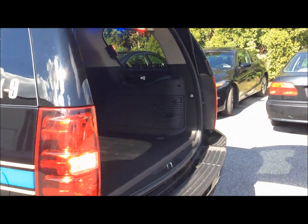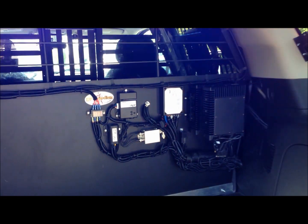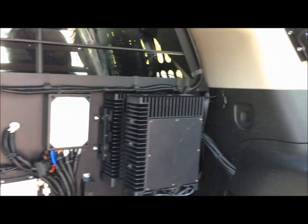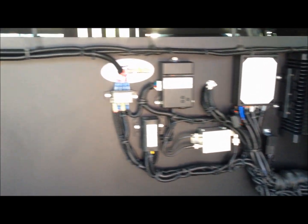In the back, you can see how we mounted everything. It's very sophisticated in wiring — everything is nicely mounted on the back of the cage, with custom fuse blocks, everything in wire loom. There are probably 100 wire ties right there in the cage. Nothing that we ever do with any of our installs ever uses electrical tape. We don't believe in it here. If it's butt connected, crimped connected correctly — nothing beats a proper crimp connection over electrical tape.